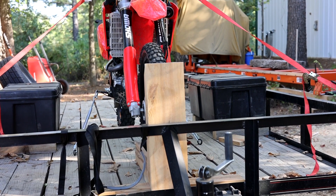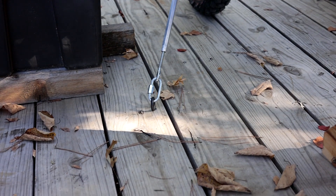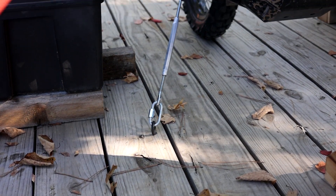One thing you're not going to see in the video: when I lean over the bike, I'm on this side of the bike the whole time when initially putting it in the trailer. The first turnbuckle I connect is on the right-hand side of the bike. When you lean over the bike you can actually use some of your own body weight to push the suspension down just a little bit to help get that turnbuckle connected. On the other side it's easy — just push down on the handlebar, get it connected, and once it's loosely tight it's not going anywhere. Take your time, make sure all your straps are straight and laid out the way you want them.